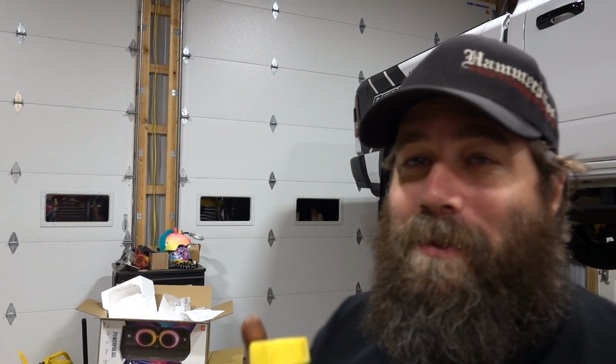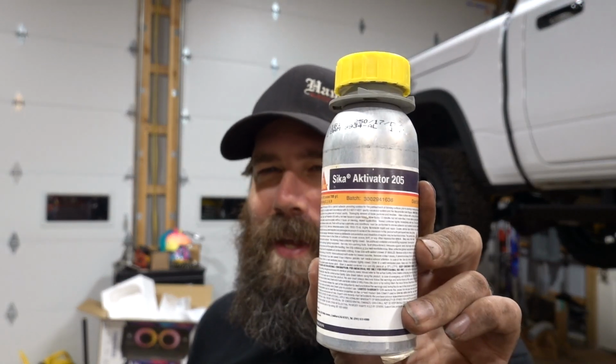And just something to keep in mind. If you want to take an extra step to make sure that everything is going to stick for a very, very long time, I have this stuff. It's called Sika Activator 205. And this stuff works really, really well. It's almost like a primer for two-sided tape. So what you do is you take a Q-tip, dip it in the bottle and lightly apply it. Give it a few minutes to dry, and then it'll really make that glue stick extra strong, just in case you're in a dirty environment where you're afraid if it starts to lift a little bit, dirt will get behind the tape and eventually the light will fall off. You have to replace the tape. This stuff I've had very, very good luck with, and unfortunately I don't know if I'll have a link in the description for this because sometimes it comes and goes from Amazon, but it is available in the world. Just gotta look for it.